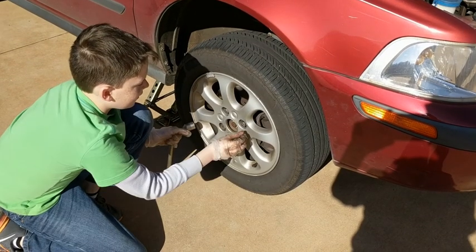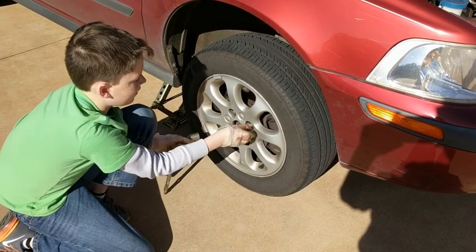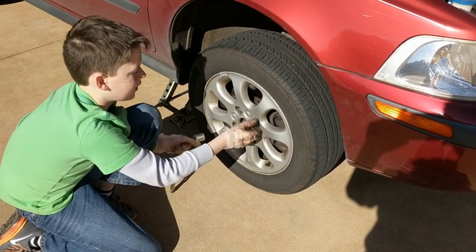Put the wheel and the brake fluid refill cap back on and take it for a spin. The first couple of times you pump the brakes, it will reset the piston instead of actually braking, so be careful. Thanks for watching!